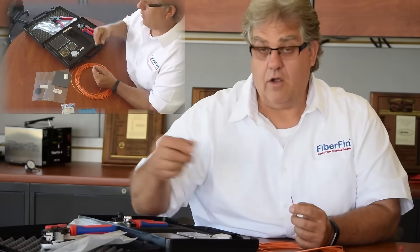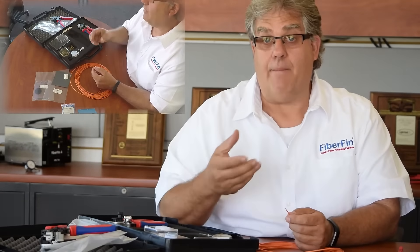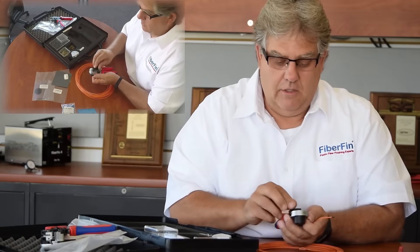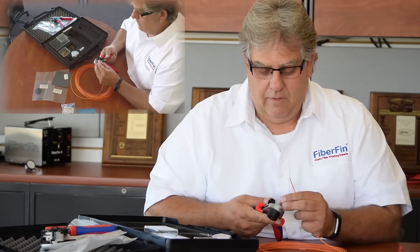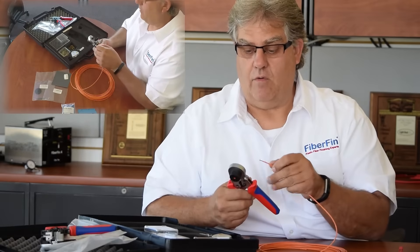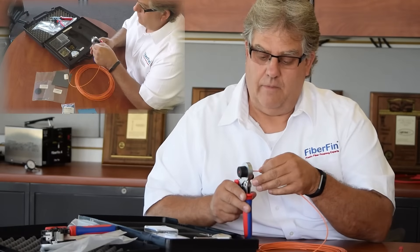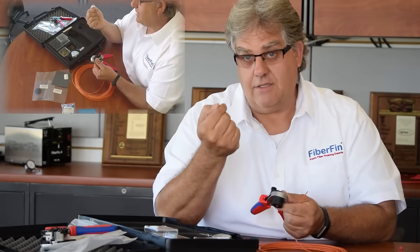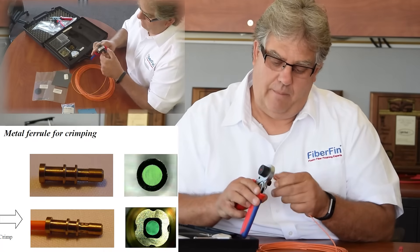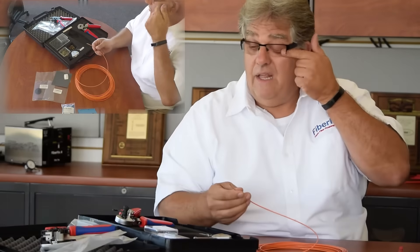Now that it's prepped, you put on a ferrule for use in an AMP or Tyco type connector typically found in automotive applications. Most of the time you'll use a male ferrule, especially on hybrids. This 4-indent crimp tool is OEM-recognized by manufacturers like Bosch, Saab, and Mercedes-Benz. It holds the ferrule in position and has a depth stop that keeps the fiber slightly recessed from the end of the ferrule — a small air gap — so the fiber end always stays perfect. You push it to the stop and crimp it on, and your ferrule is done.